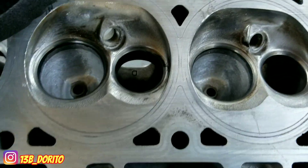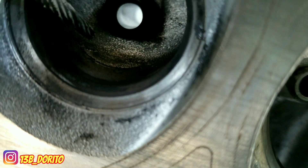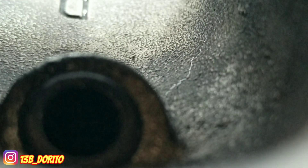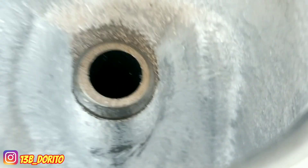The next one is the exhaust. On the exhaust, we're going to get rid of this belly here — all the roughness — and make it smooth. We're also going to flush the valve with the guide, with the aluminum on there. See all this right here — this one right here is going to get removed. All of this is going to get flushed into the valve guide, same as the intake.